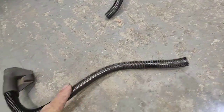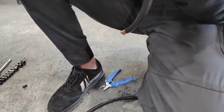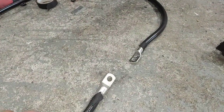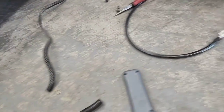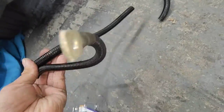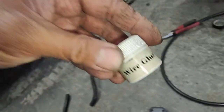If the cable was just separate — like how we're doing it now — there's one here and another one here. This one is for the alternator and that's for the starter motor. We're making them separate, so it's not going to have a massive current draw due to sharing one crimp connection.